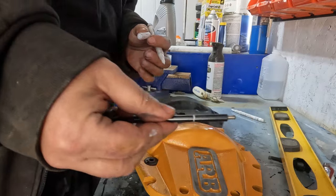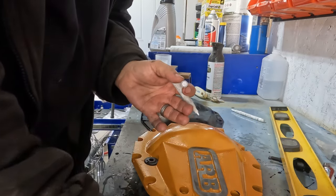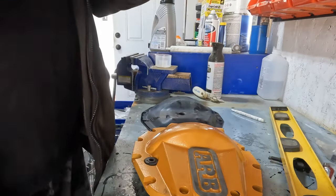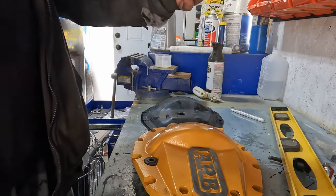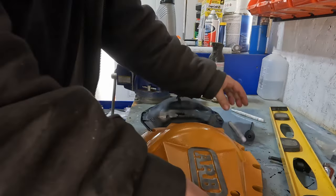What I wanted to do is kind of line up where these two sit — the bottom of that drain hole is where the fill line falls — so I can mark that right here as the fill line. I'm just putting a mark on there so we know where our fill line is. When I check the dipstick I can easily say whether it needs more or is too full, and adjust from there. Easy peasy.